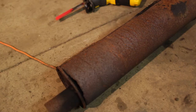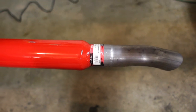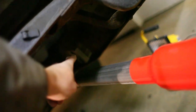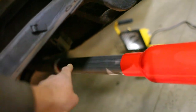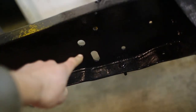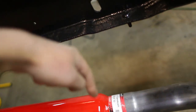It cut right through the old pipe. I just got back from AutoZone again because the muffler we had was the wrong one. So this is the new setup: a piece of straight pipe that fits over the original exhaust — they call it the Y-pipe — which comes from the manifolds down and terminates there. It's got a hanger on a bracket, and we'll clamp on that section so it's removable. We've got a straight section, the cherry bomb muffler, a turndown at the end, and a rubber hanger bracket that will mount a quarter-inch rod.